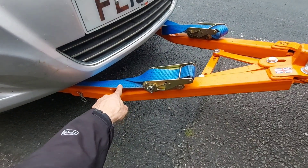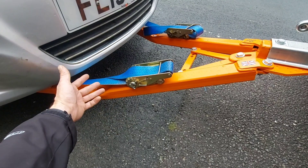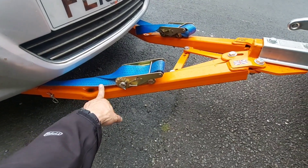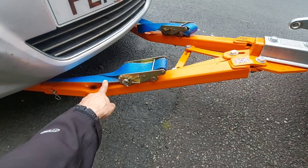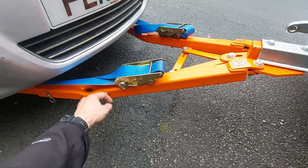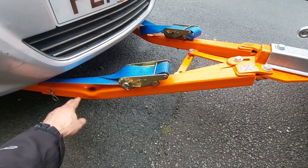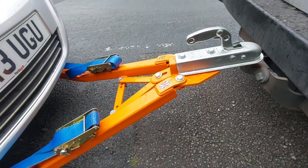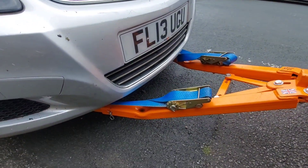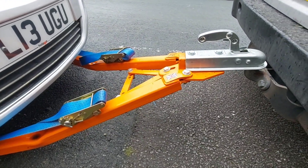Yeah, these are absolutely fantastic, as long as you make sure you do these up tight and you always check them — every five or ten minutes, or if you feel or hear any funny noises. I unfortunately got the warning: I heard a scraping on the wheel twice, and then it was loose and the bar slipped from underneath, and the vehicle was over to one side. Luckily the other one was still on so we still had control, but yeah, a bit hairy for a moment there. Anyway, thanks for watching and I'll see you again soon.